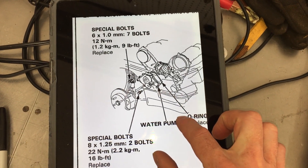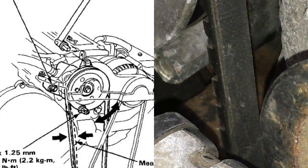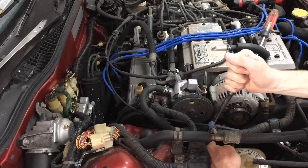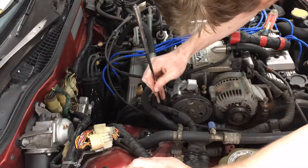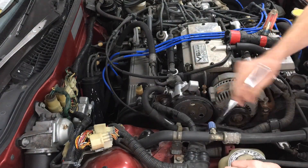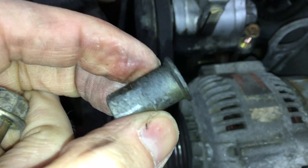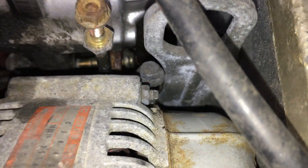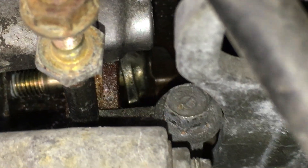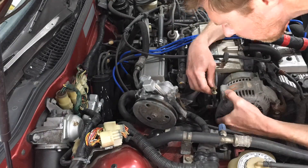I'll put a link in the description. If you look down below the power steering pulley, that's the adjustment nut, and up on the back is the pivot bolt. The adjustment nut felt kind of seized, so I hosed it with some PB Blaster and loosened the pivot bolt first. Then I dropped the bolt and recovered it with a magnet. After that, the adjustment bolt was ready to come out. Here is the pivot bolt and the adjustment nut from under the pulley. You can see the adjustment bolt still going through the bracket and the pump, so I pulled that bolt out through the back. With that bolt removed, I could move the pump out of the way and fully loosen and remove the adjustment bolt for the alternator.